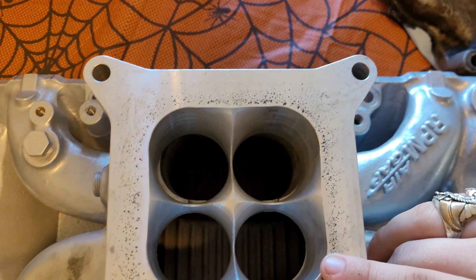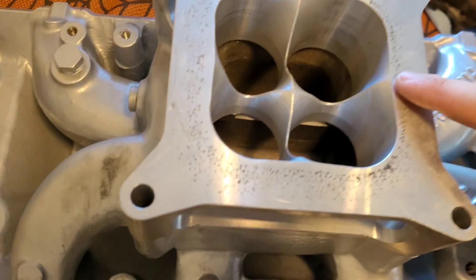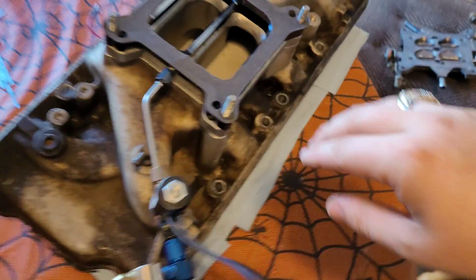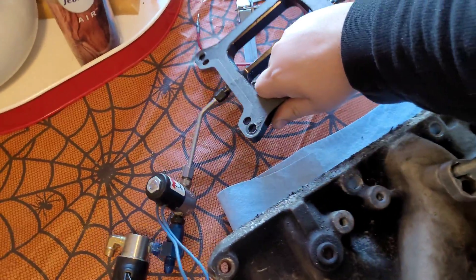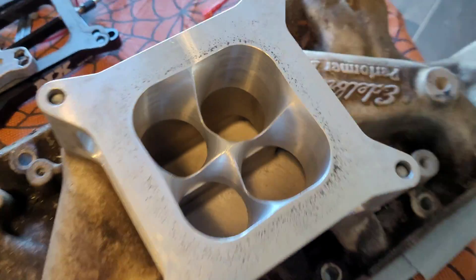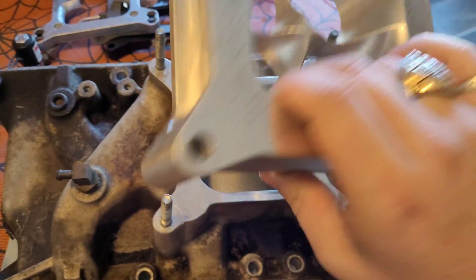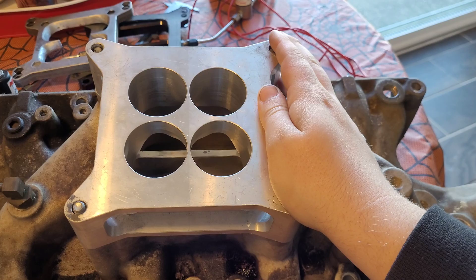Let's mount it up on the old intake and take a look. Now it's up on the intake as it is designed to be. The biggest thing we can really see — look at that giant divider line — to me, that looks like it would be impeding flow and causing turbulence down there, especially there in the corners. That's the only thing we can physically see inside the intake that would make any sense on why it would not be optimal. So let's flip it upside down. Now, without my nitrous plate and custom spacer, you've got to admit that looks a whole lot more streamlined.